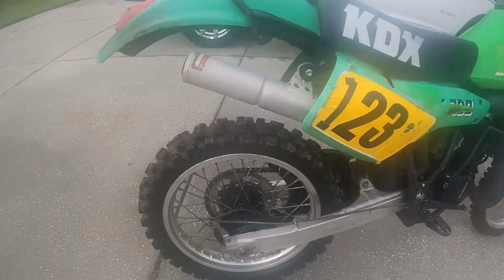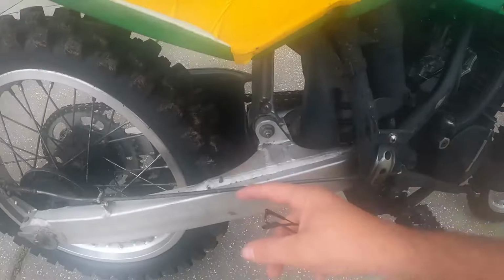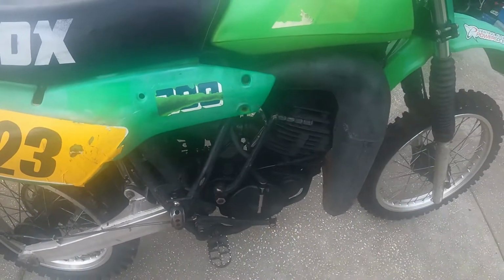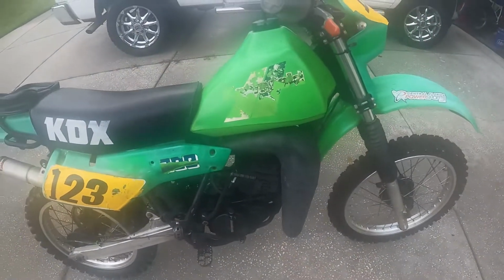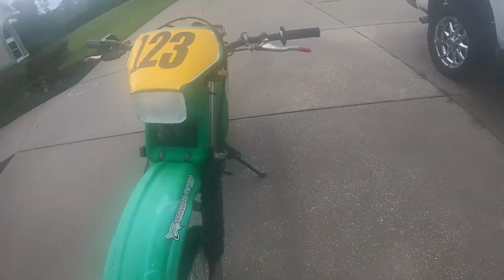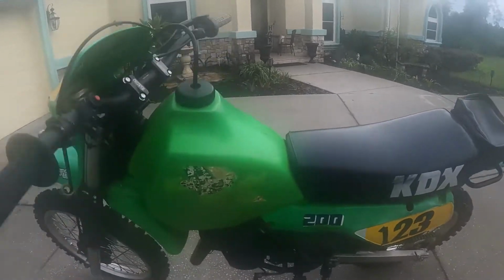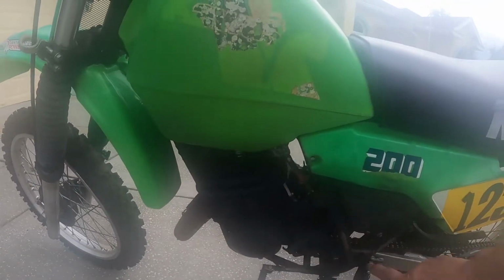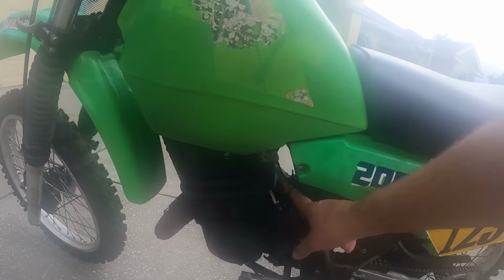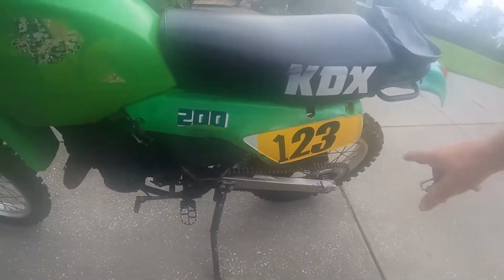But right now, I can tell you that he gives me the bike, he brings it over, which is great, except he brings it over dirty. Like, this thing is full of sand and crappy. So the first thing I'm going to do is wash it, just so I can see all the parts and pieces. I'll give it a bath, and then I'll pop everything off and take a look. I'll pull the spark plug out, take a look. This filter looks okay. Pull the air filter out of here, and then get up on a stand and start pulling it apart.